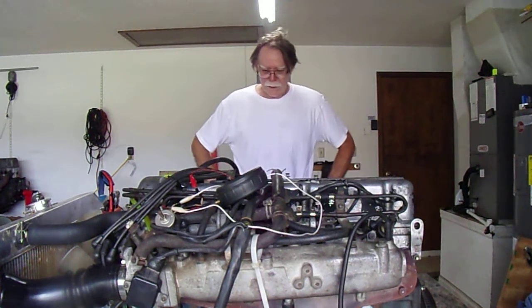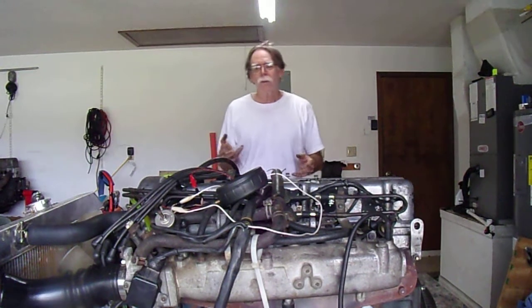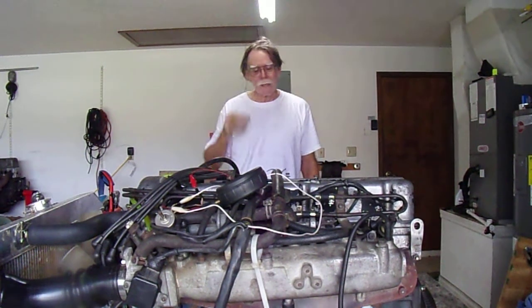Okay, guys, here's the deal. I was fooling around with the, you can see me on the frame. I was fooling around with the airflow meter to adjust the air to fuel mixture and checking that by using a narrowband oxygen sensor hooked up to a voltmeter. And I noticed it was chronically running lean. I could actually move the air vane a little with my hand.